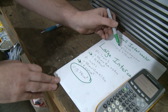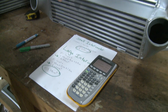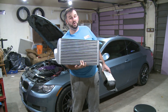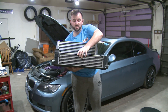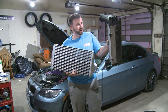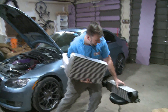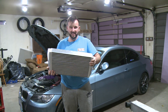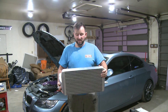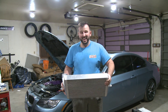Comparing that to the original intercooler at only 6,732 centimeters cubed, this upgraded intercooler is at least three times the size by volume. The small one holds about six or seven liters of air, while this king holds 19 liters — 19,000 centimeters cubed. That means we can cool air down much faster, way more efficiently, and this car will be faster yet again next summer. Thank you for listening and I hope this helped.